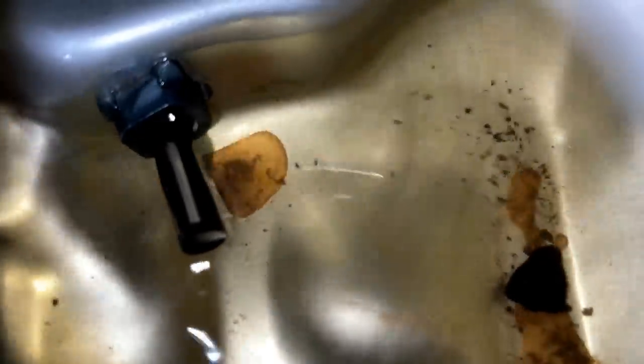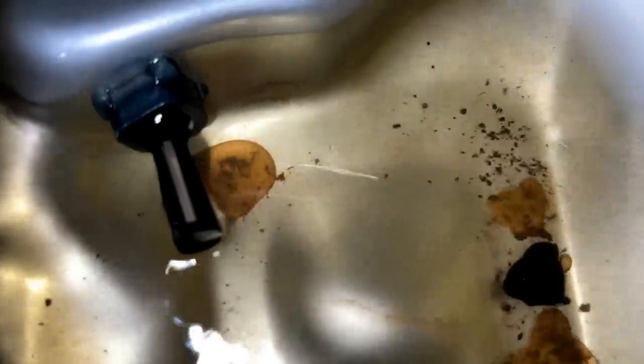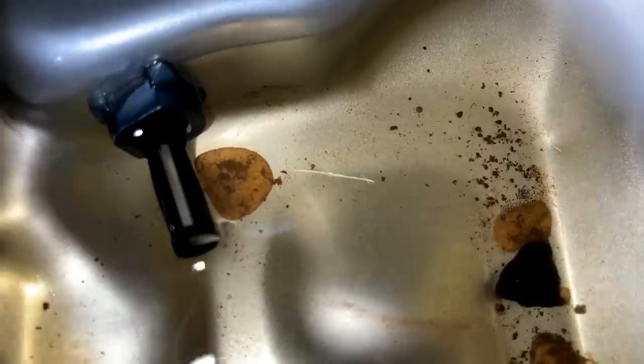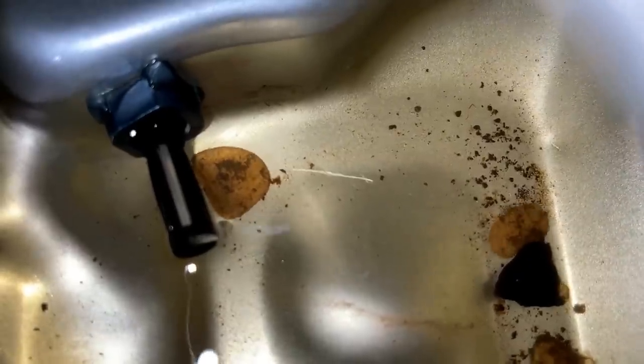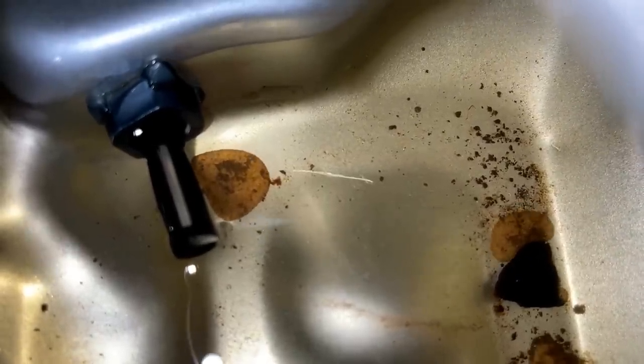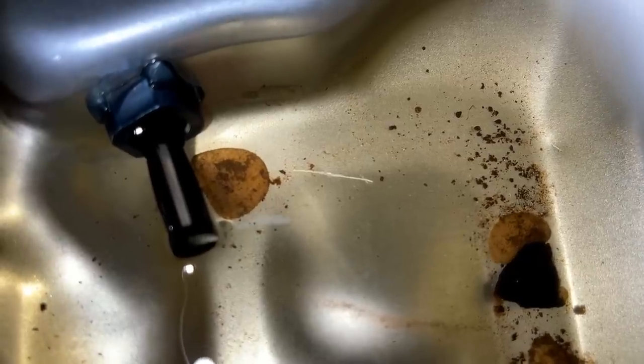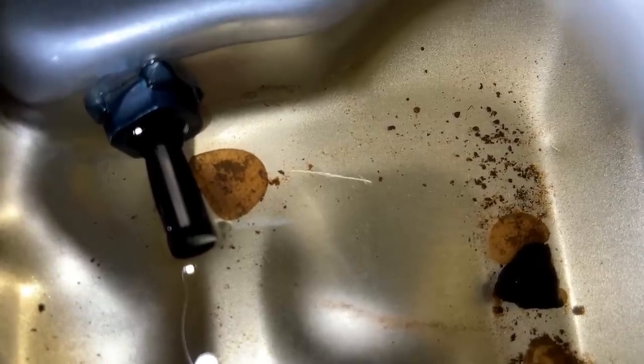Yeah, and there is some water in the bottom of the tank. Thankfully, the tank itself is not rusted out. Anyway, that does need to be cleaned out, but not a concern right now. If you see in the top left, that is the fuel pickup, and that's not on the bottom of the tank, so there's no danger of picking that water up.